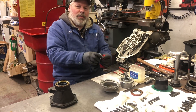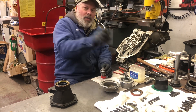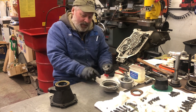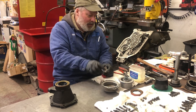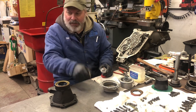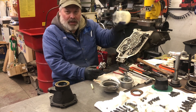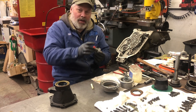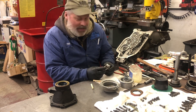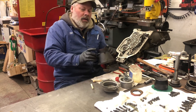I changed the seals in the speedometer. The driven gear in here has a small spring — you always, when you're picking it out with your small pocket screwdriver, keep your finger over the end because when that thing clears the end of the hole it's going into orbit. Going back in, same way, I tuck the seal with a pocket screwdriver. This one's round on the end but there's a flat one which works a lot better for pushing down the seal all the way. I dip the driven gear, put some lube on it, and when it goes in it should pop into the seal and hold itself. If this housing wants to fall off the gear, it's probably going to leak. So I lube the outside O-ring, stick that in — no problem, and the tail housing is all ready to go.